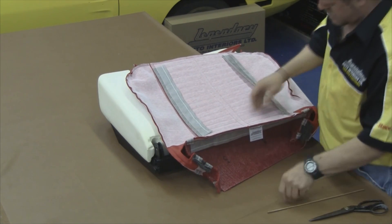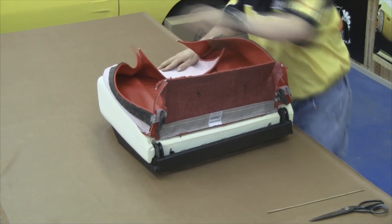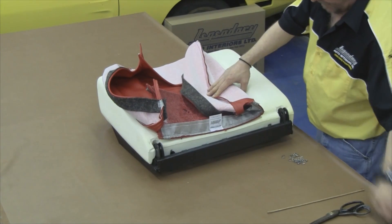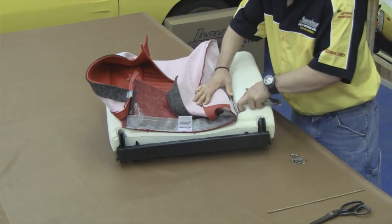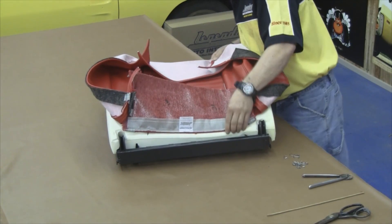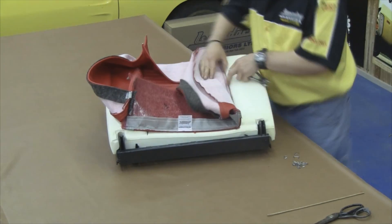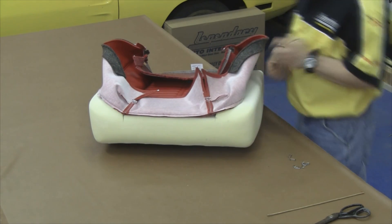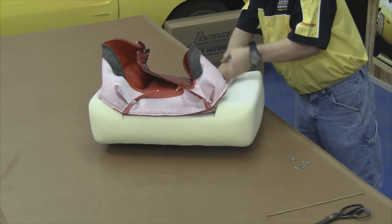The first step in our seat cover installation is to insert the paper-coated listing wire into the listing pocket that's sewn into the seat cover. Make sure that the listing wire does not overhang the outside edges of the pocket. We want to symmetrically place our seat cover on top of our seat spring and our molded foam, making sure that the hinge area cutouts line up, and then tuck the insert pocket down through the molded foam and attach it to the listing wire that's attached to the top side of the burlap. Before you put too many hog rings in, keep checking to make sure your cover is symmetrically installed — you don't want it twisted. We want to put three to four hog rings per side to anchor the listing down through the molded foam. Keep checking your seat cover installation to make sure there aren't any wrinkles.